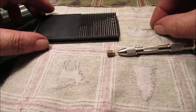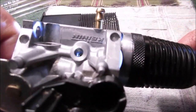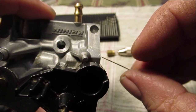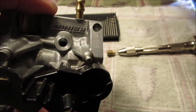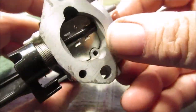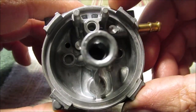Here's our progress so far: we couldn't find a drill bit to fit this low-speed jet — it's so small. I had a flashlight shining in here and just put a sewing needle down in there. It just fit partway and I kind of twisted it a little bit while holding it in a pin vise. That Chemtool B12 stuff ate my blue Harbor Freight gloves — they're not the right gloves for that. Fuel from the low-speed jet gets it there from right in here; the main jet gets it there from here.